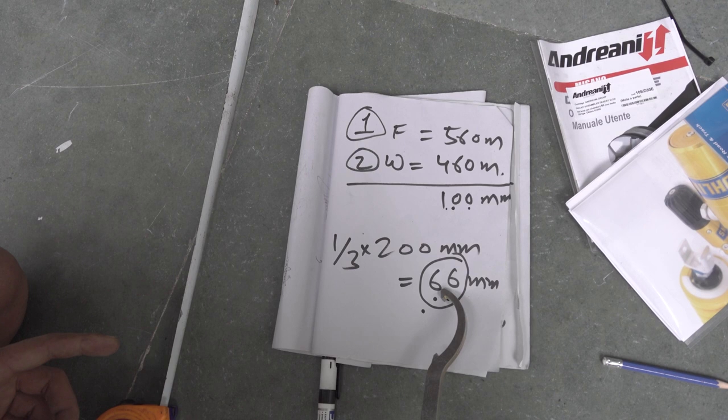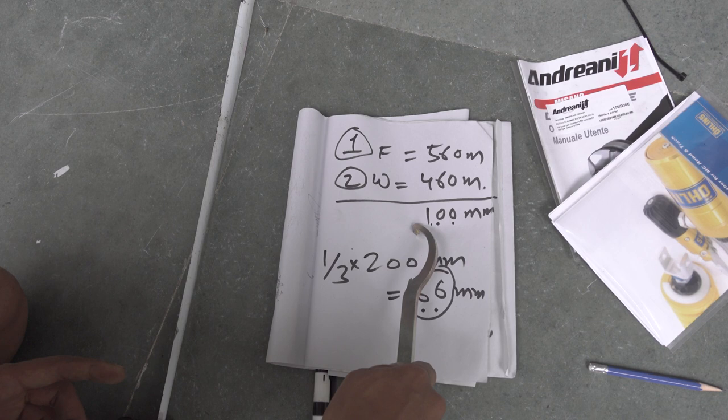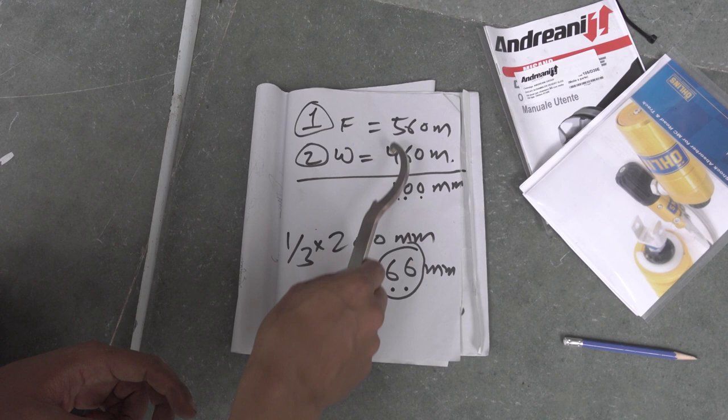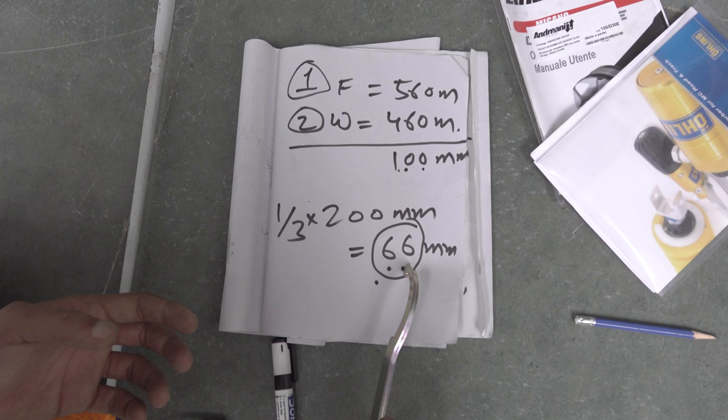So if you take a look at it, 100 millimeters — that's a little too soft, because our rear suspension has a little too less preload on it, giving us a greater sag distance. What we want to do is make sure it comes around the recommended target value of 66 millimeters. For this, we need to stiffen up the suspension a little bit — add a little more preload. So how do we do that? Come over here.